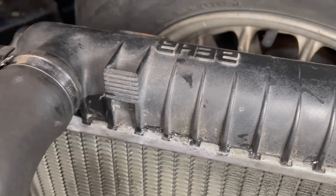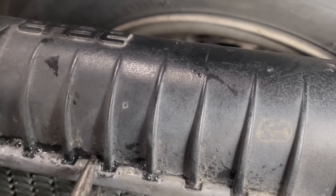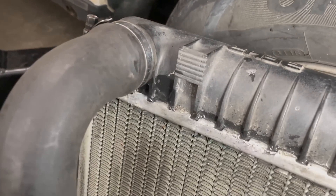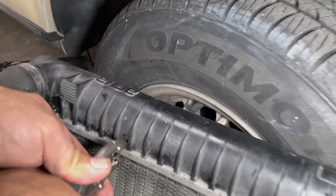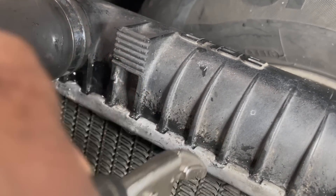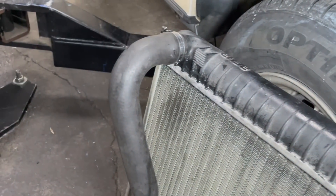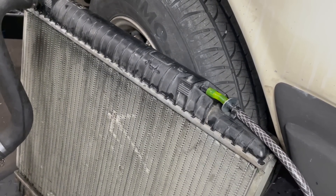Should I try to crimp this up and save it, or should I admit the reality? If this doesn't make you a believer in the importance of a coolant system pressure test, I don't know what will. Maybe vice grips will work — let's see, squeeze it down there, we can save some money. Now that one's leaking — oh, this one's leaking worse over here. Gerson says we can fix this. At least this is something we could show people who go out on the road and have a leak in this area — they can crimp that down enough to get home. Just for fun, we're going to crimp the whole thing and retest.